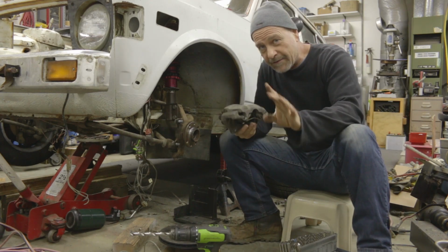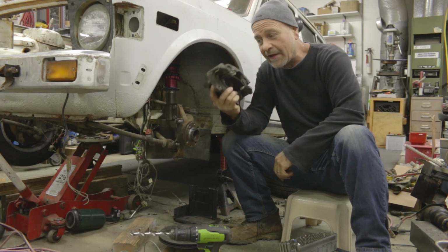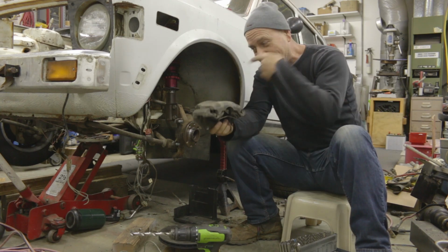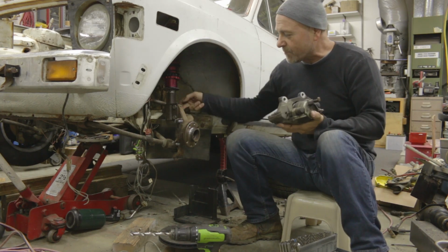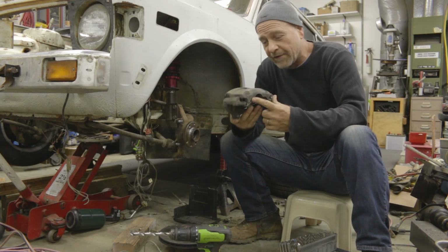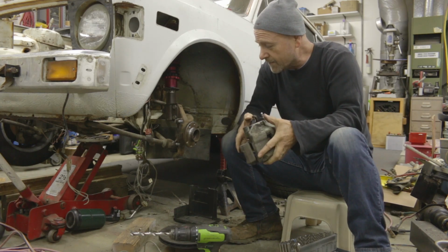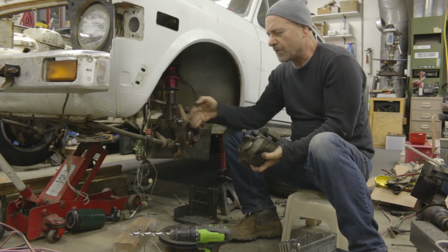And this is something for a lot of the Fiat X19 guys: I believe that this will actually fit inside a 13-inch wheel. I'm not exactly sure. I've thrown away all my old 13-inch steel wheels that came mounted on this. I took them to the recycler. But I can do some measurements from the center of the hub to the highest portion, and give you a radius, or a possible inner diameter. As you can see, the back edge of the calipers goes a little humpy, and that would most likely rub on it. Or possibly the front face, however it's mounted.